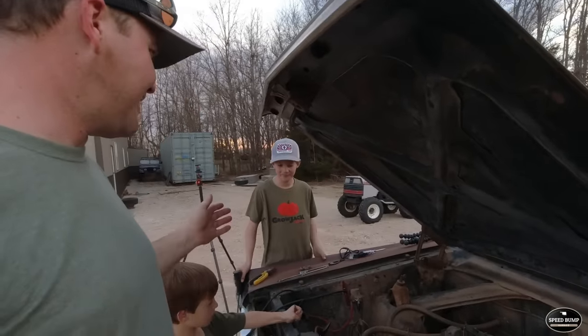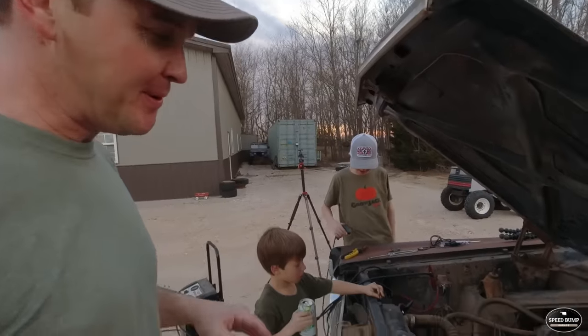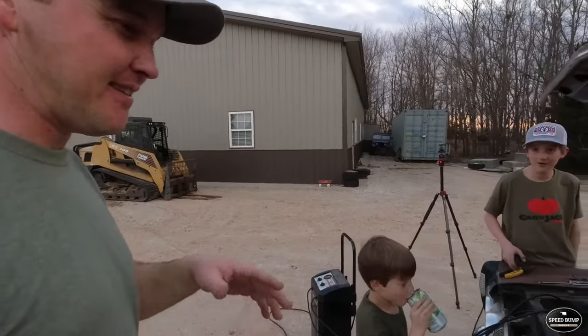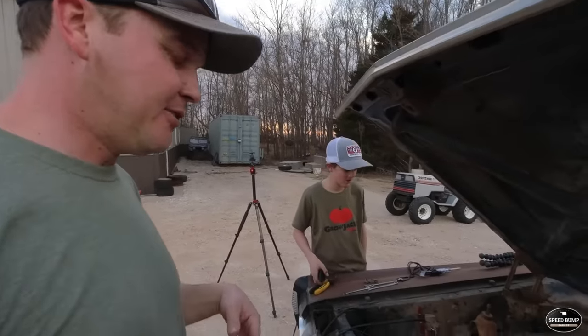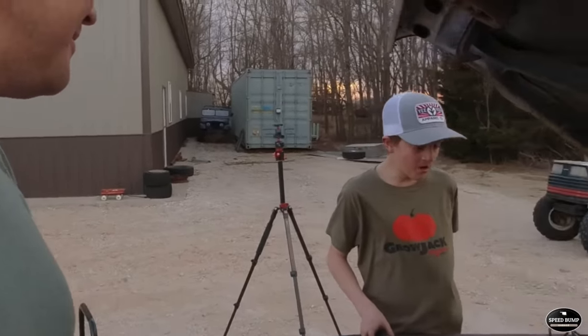I think what your next step should be, I'm gonna give you a little advice, is that okay? I would pull the spark plugs, see what they look like. We obviously haven't looked at that, and maybe shoot some PB Blaster or something down these cylinders, let it sit for a day or two, get all that stuff.